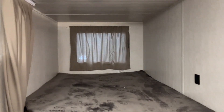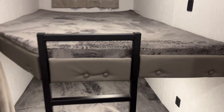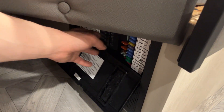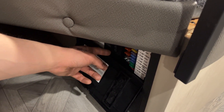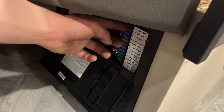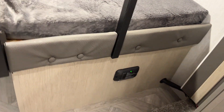Your bunk spaces each have their own little lights on their own center push buttons — both identical spaces. Underneath, in your doghouse storage, you've got your converter. Press the top center and it'll pop open. All your breakers are in the middle — whenever a breaker trips, it sits in the center, so just turn it off and back on to reset it. All your fuses are on the right side — whenever a fuse pops, there's a little red LED right beside it letting you know exactly which one went.